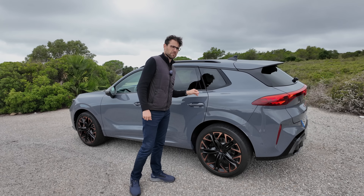The steering is really direct — progressive steering is standard on this vehicle, not optional. Progressive steering means you don't have to steer too much to achieve what you want. Fine commands are transported smoothly, and it increases progressively towards the outside when doing larger inputs. You don't have to steer all the way around just to do one corner. It's working very well, also in comfort mode with the DCC Pro.